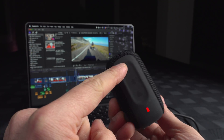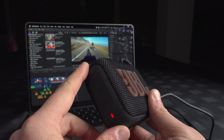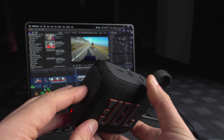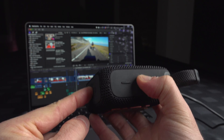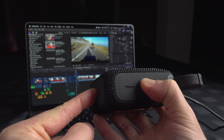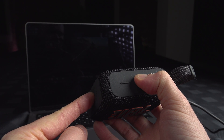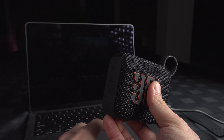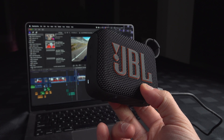First thing you need to do is to power on — press the power button. Now that it's on, you will press and hold the Bluetooth button and the play button at the same time. Hold those two buttons for 10 seconds, or until you hear the power-on chime. There we go. Now you can release those two buttons and wait — you're going to hear the turn-on chime, just like that.